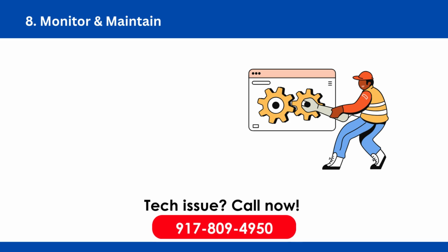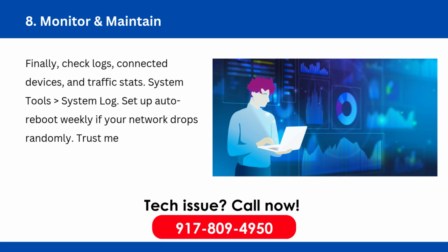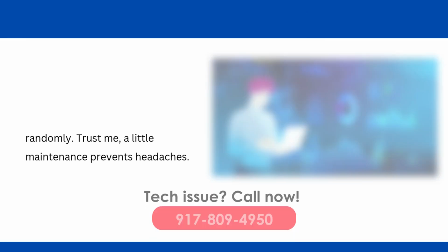8. Monitor and maintain. Finally, check logs, connected devices, and traffic stats. System Tools, System Log. Set up auto reboot weekly if your network drops randomly. Trust me, a little maintenance prevents headaches.